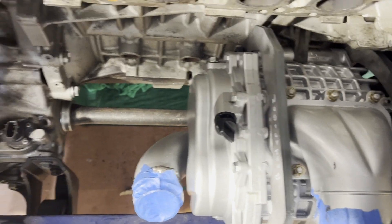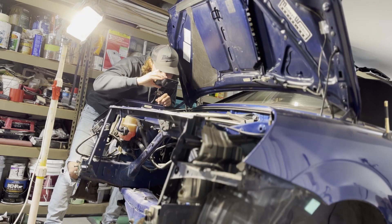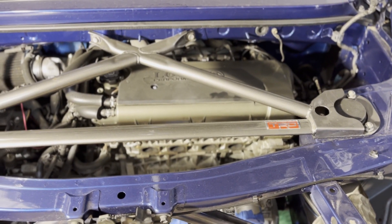Since the first couple videos of this car I've been saying I want to make a full stainless exhaust, and I knew I'd have to include the header because I knew I was going to have to make space for the supercharger in this location. I decided to engineer this header in a way that will be easiest to manufacture. I ended up using a free 3D scanner app on my iPhone — you can get these on any phone, most cameras can handle the LiDAR — and I did a full scan of the engine bay with the supercharger installed.